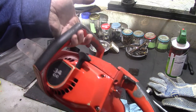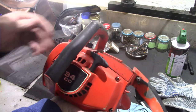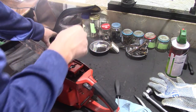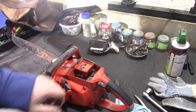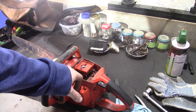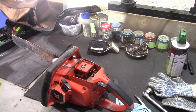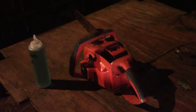The screws look straight — it just looks like it's been painted at one time. So I'll get the shoulder cap set aside so I don't lose it. We'll get some two-cycle, take it outside, drop a little down the carb, and see if it tries to kick. The fuel line going up to the carb is rock hard, so I'll just try to fire it up rather than putting fuel in the tank since being this old it could leak.